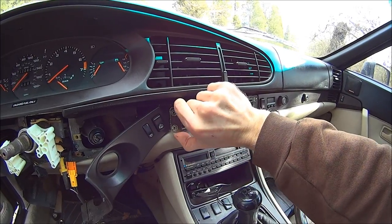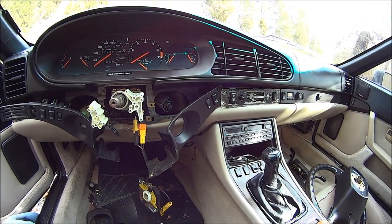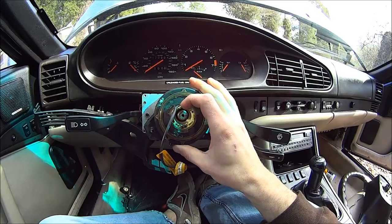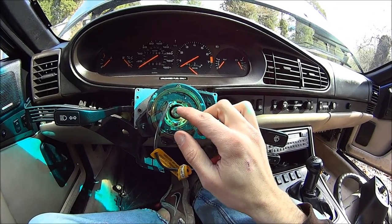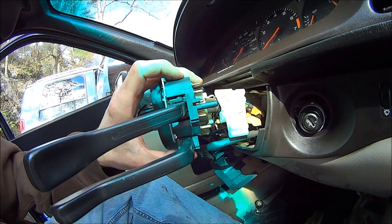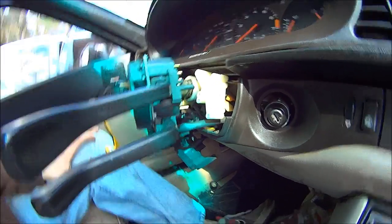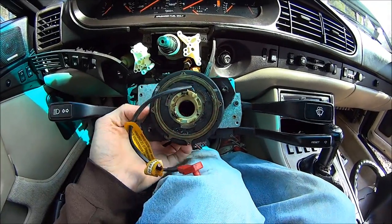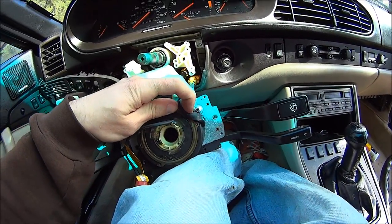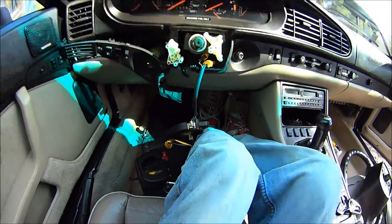Pull the climate control out a little bit and then this will come off. Once that's loose, you can pull this off — don't let this thing move too much. Refer back to your video or picture, or put a mark, zip tie it, or tape it. When you're pulling this off, just grab it with one hand and pull the plugs off with the other. You can actually take this assembly off with these two screws here — don't let it move too much. And you can let that hang there and you've got your switches.